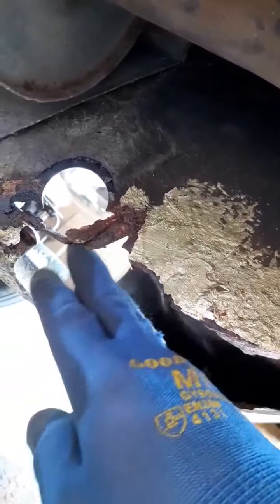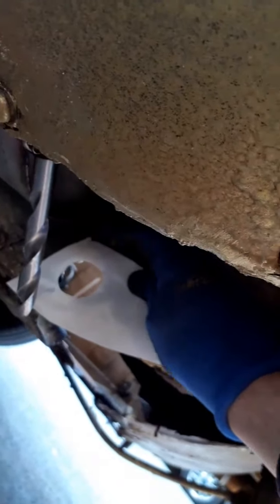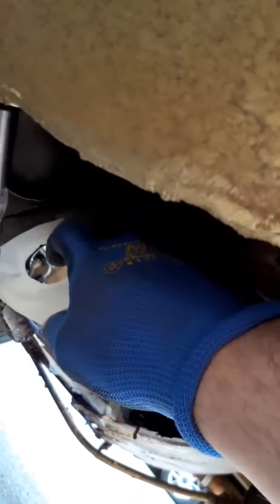Can I get the camera in where it can see? Here we go — there's a 90-degree fold just here, so obviously we've got metal missing there, we can see daylight straight through it, so that's got to be filled in, but it does have a fold. It's an easy enough repair. Basically where we see the white paper, that'll be new metal, a new hole for the fuel line to go through, and I'm buying some new grommets — I've ordered them — they're large grommets that have a hole in just for the fuel line to go through.